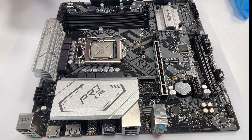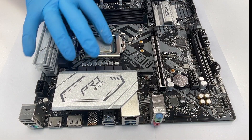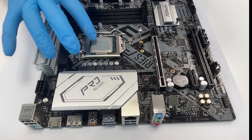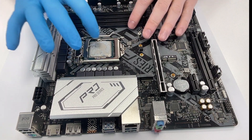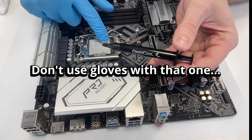However, the results depend on how much paste you use, the thickness of your lines, and how evenly you press the cooler during installation. The spreading method involves applying thermal paste to the CPU and using a spatula or your finger to spread it evenly. If you are a complete beginner and plan to use thicker paste like Arctic MX-6 or Deep Cool, save yourself a headache and just use the cross method, as they tend to peel during spreading if too much force is applied and can be a nightmare to spread into a thin layer.